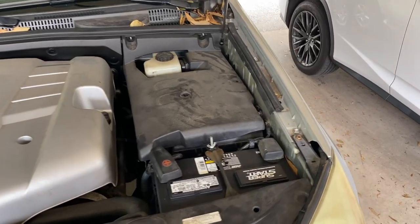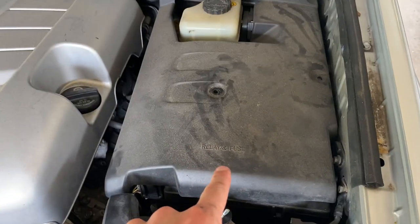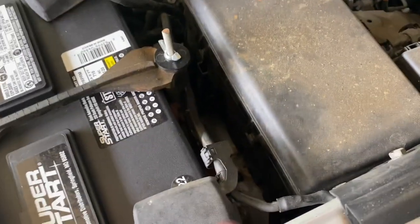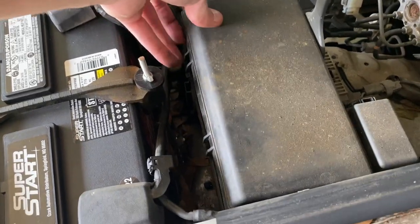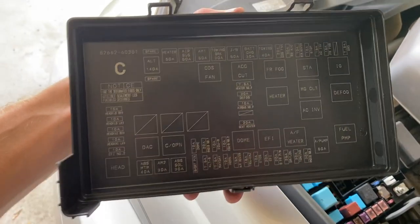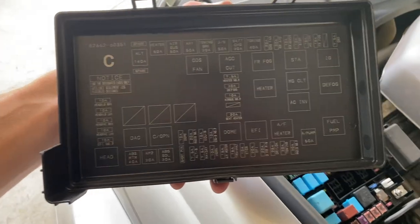To wire the lights, you're first going to want to remove the tabs here, here, here, and here in order to get to the fuse box. You then want to come down here and unclip the two clips that hold the fuse box cover on. On the underside of the fuse box is a fuse diagram, and now we're going to pick out our fuse based on this diagram.